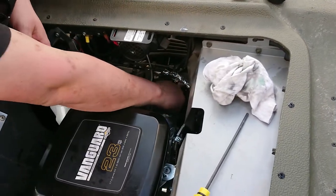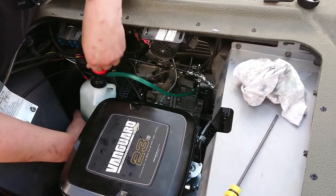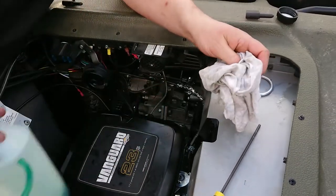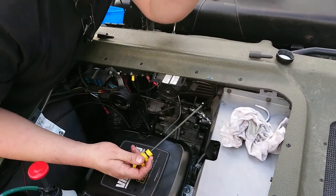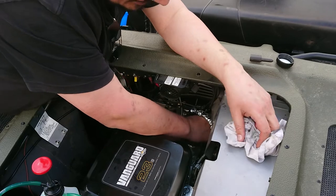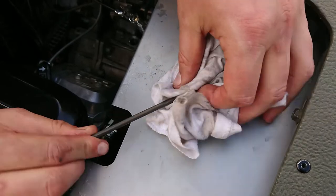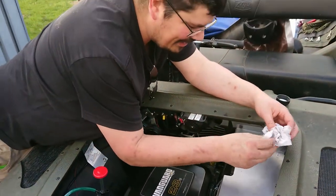We're nearly ready and the rain is coming in. We're right on the low mark. A few more pumps and we should be right — I like to be just a little bit above the low mark. The high mark is for when it's hot. We'll wipe it clean, whack a little bit more in, and it'll probably come down a bit once we run the gearbox because it'll disperse around. I'm nearly out of oil anyway, which would be about one quart. Even though these are made in Canada — which intelligently uses metric — they didn't use metric nuts and bolts, they used UNF.